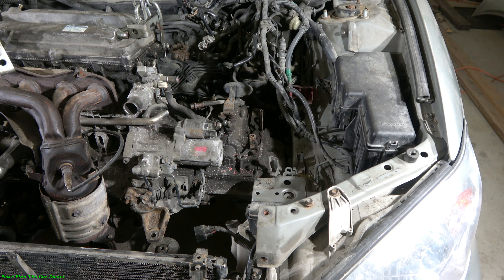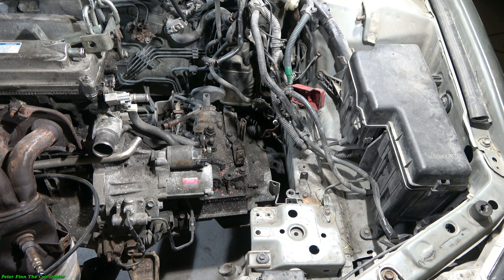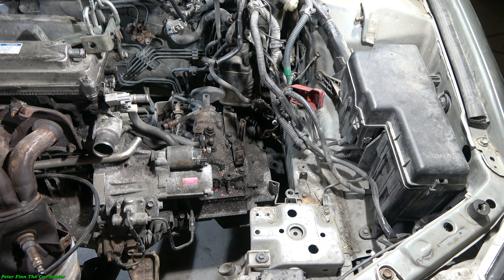It looks good and then I can lift that engine more. I noticed that I have to take some metallic plate away in these mountings because the mountings are taking contact with the car body. Now that I have removed this engine mounting, this engine is quite well coming up.